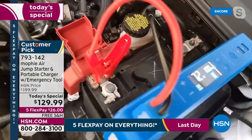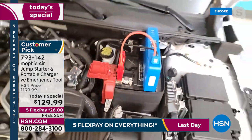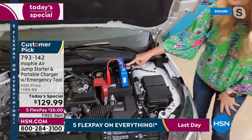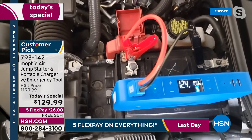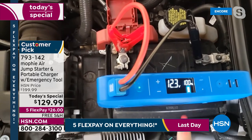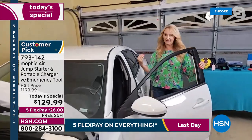You can see on the screen right here exactly how many volts your battery is. Yeah. So Adam, this 7.2, so anything less than 12 is truly a dead battery. So I'm gonna simply tap the button right next to where I've plugged in my jumper cable. You see that green light is blinking. It's processing through a series of safety checks. As soon as the green light goes solid, you can see that it's delivered over 12 volts of power instantly to the vehicle. So I'm gonna be able to get in.